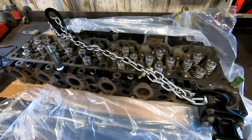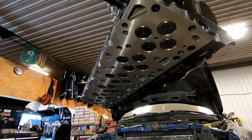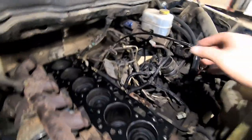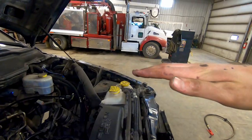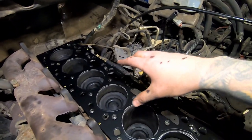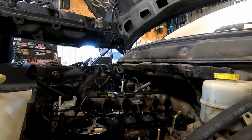Get your chain on your lifting hooks and away we go. Same as when we removed it, it's good to put some screwdrivers in here so the hook can't jump off the chain. Just before we put the head on, spray it off with a bit of brake clean and air to make sure there's nothing on the bottom. Getting ready to put this head in — make sure everything is out of the way. When we put the head in, we're gonna angle it down, move it forward, and once it's past the firewall we'll set it in. Once it's close to resting on the block, wiggle it back and forth until it drops onto your dowels.